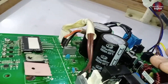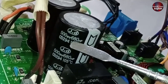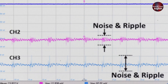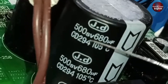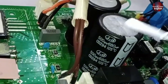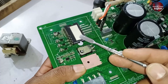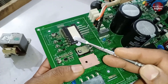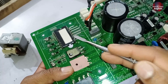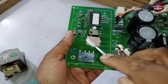These two large capacitors are rated at 500 volts and have a capacity of 680 microfarads. These capacitors are commonly connected across the DC output to smooth out ripples and stabilize the DC voltage. In addition to ripple reduction, the capacitors also act as energy reservoirs — they store energy during the peak of the rectified AC cycle and supply it during low points, ensuring a steady voltage is delivered to the load. The compressor is connected in series with the collector and emitter, and the positive side of the capacitor is directly connected to the IPM.